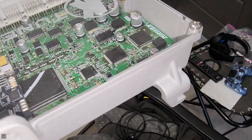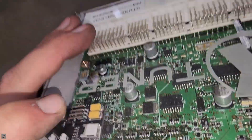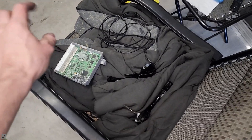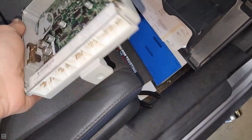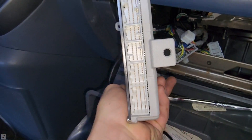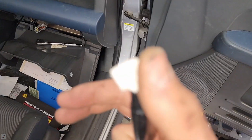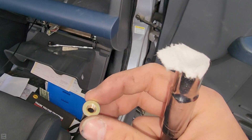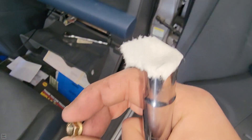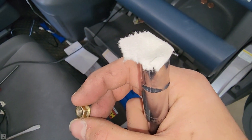Now we need to set up our new one. See this little hole right there? We're going to want to plug our connector into the board and run the wire through that hole so that we can actually talk to the ECU. Let's get that casing off and get that plugged in. I'll show you guys plugging in our little wire there — now we have a lead coming out that hole and we're eventually going to plug that into a laptop. Same way as it came out, just put it back in. A little mechanic trick: put some toilet paper on the end of the socket, then push the nut onto the toilet paper — it'll hold it in there so that it doesn't fall out while you try to get to a stud that's all the way back where you can't even see.